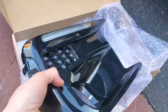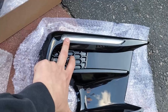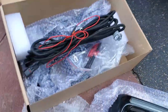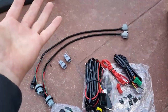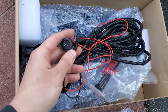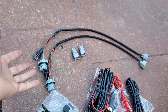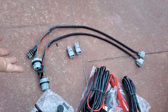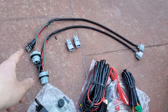For the bezels, this is what you get: a white DRL with a sequential amber that's also switchback, and the harness that comes with it. This works with base models. For limited models you're going to need an additional harness if you don't have the LED headlights. This right here is what switches it from sequential to switchback — this is the SubiSpec JDM fog light bezel signal harness that's plug and play for limited models.